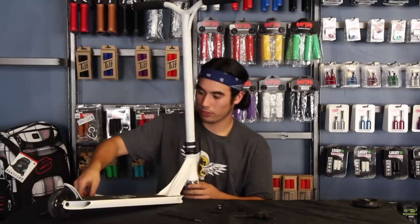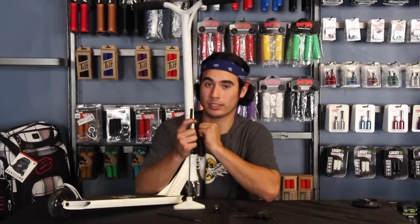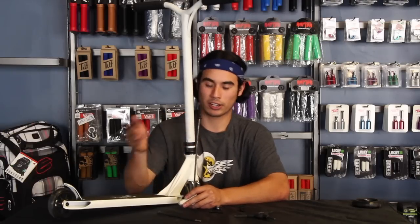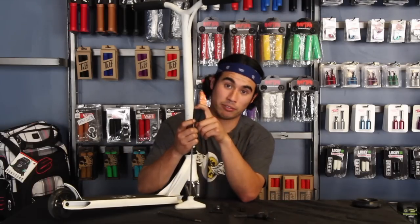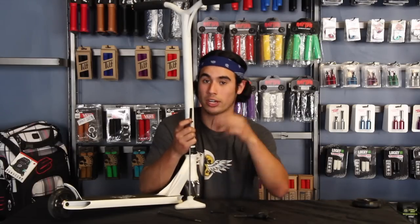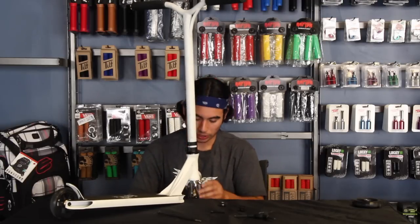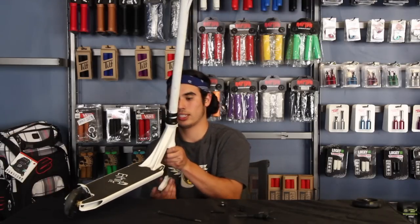For the most part, ICS is sort of the compression, being that the Ethic bars have the built-in star nut, it's not easy for them to pull out, so you can actually potentially use this bolt. It's kind of contradicting what I said earlier, where this bolt actually can compress everything together, being that this bolt is big enough, a thicker gauge, so it's a lot stronger than this bolt, and the star nut wasn't hidden like this. It's more formed in there when it's made. So we're gonna go ahead and get started. We just slide it in the inside of the fork